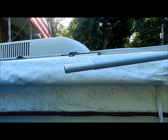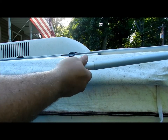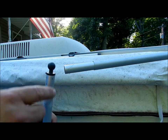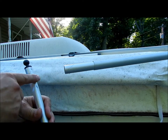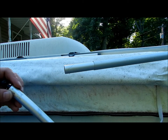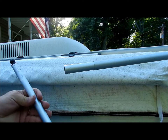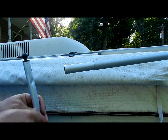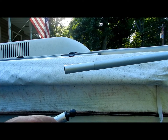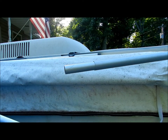With my wife's help, it worked out. Holding this side, we pulled this tube all the way out. She held it with a pair of gloves, and I grabbed this part with channel locks and turned it. I'm not too worried about damaging this. This is the dent right here that caused the whole problem. Now what I have to do is probably saw off both ends with a hacksaw or something.